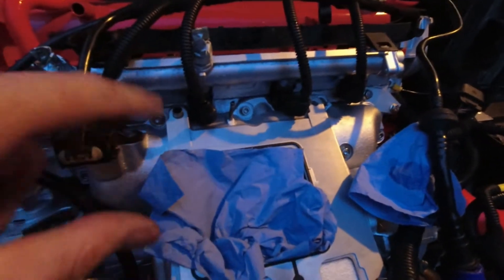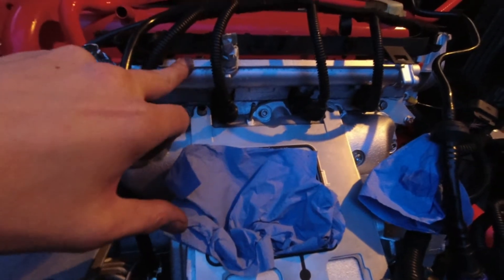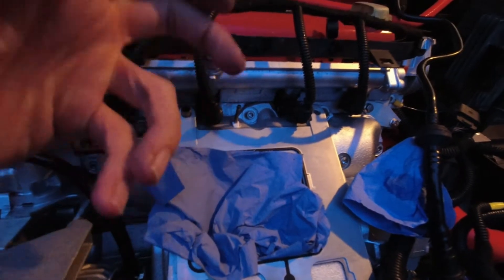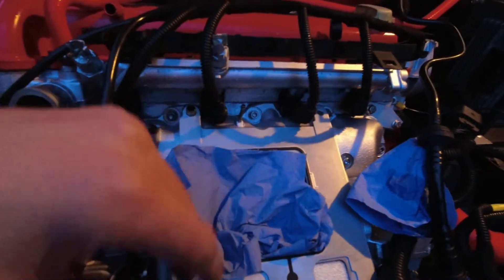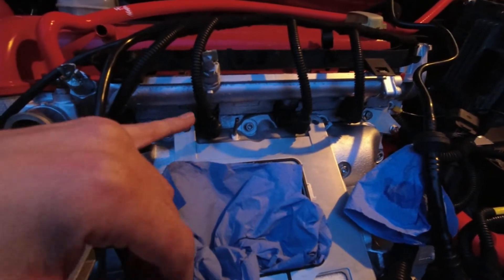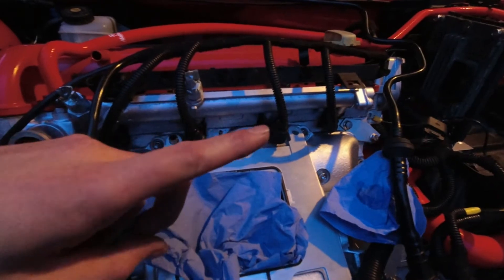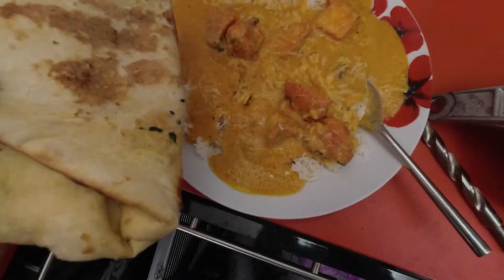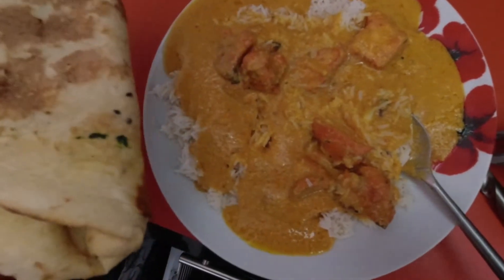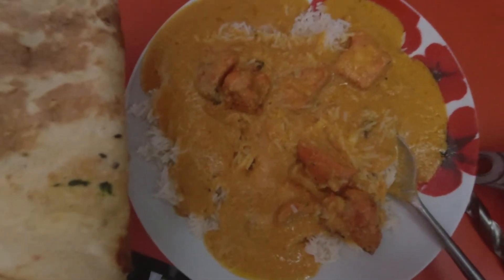That was a fun little one. I had the injector rail mounted and then came to put the plugs on, but the space is so tight you can't get the plugs on with the injector rail fitted. So I undid the two screws, lifted the injector rail up a bit, fitted the plugs, then pushed the injector rail back down. Those plugs are under a bit of strain but I guess that's normal. Injector loom is in — these things always take a little bit longer than expected. Also, don't forget to eat during the supercharger install — tonight we've got butter chicken curry, naan bread and rice.